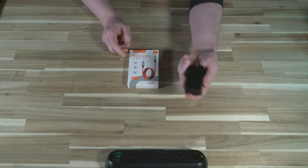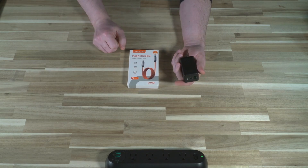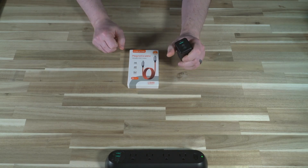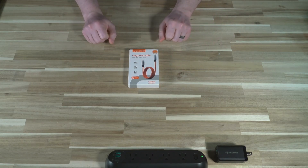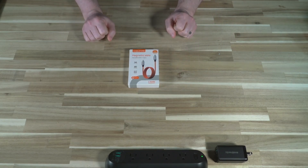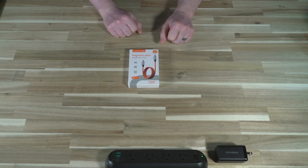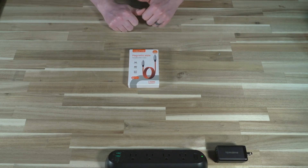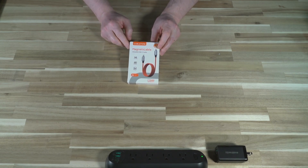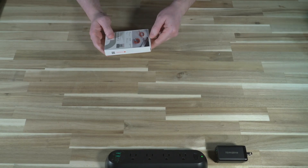If you have something like a GAN charger like this one here — and if you want to learn more about that you can check out my channel — then you can probably push down enough power through the cable that it will actually work well. One thing to be aware of when you enter these charging cable markets is whether your charger keeps up with the cable or vice versa. They come in two varieties: a 1-meter at $10.99 and a 2-meter at $15.99.